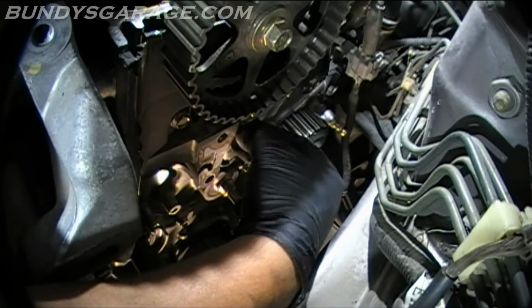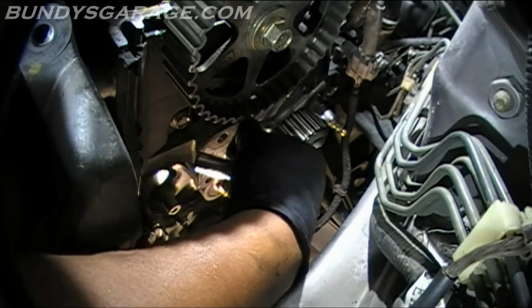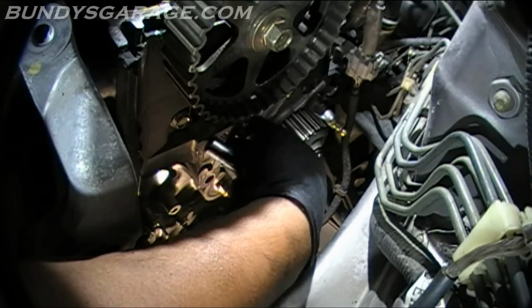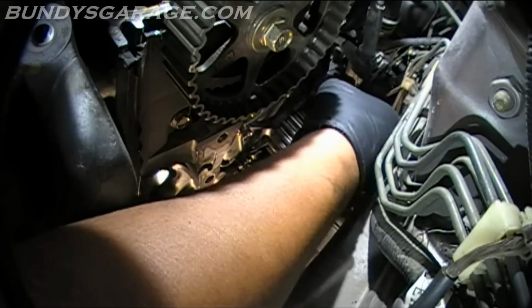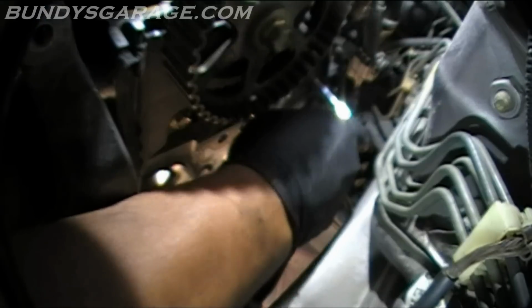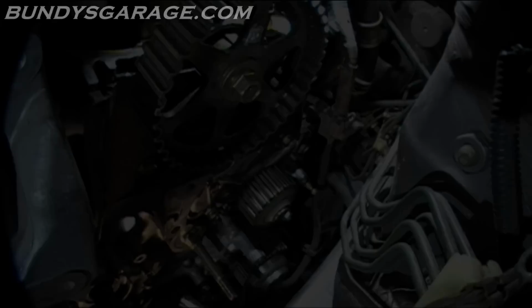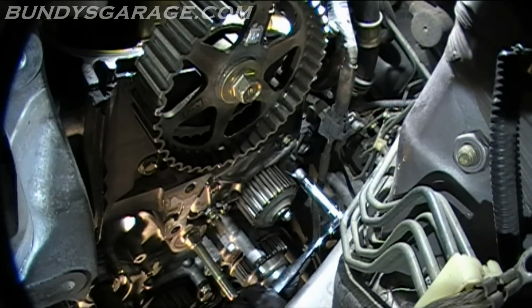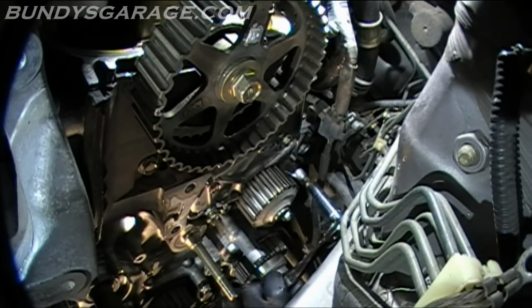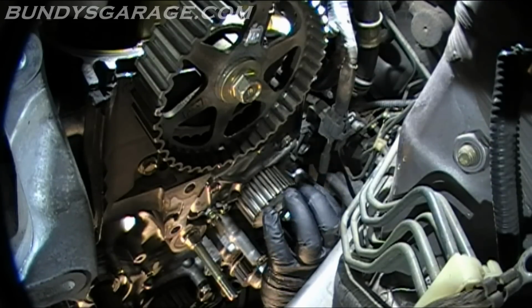I'm going to have to come up here from the bottom. As you start loosening these up, you'll start getting coolant coming out, so don't be worried. Another thing you'll want to check after you get this thing off is to make sure that the rubber O-ring is free and clear from the engine block. Just remember where this one goes, it holds the spring on, so just be careful when you put it back in. Make sure you put it back in the right place.